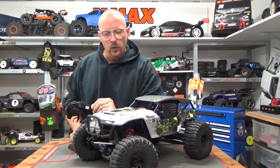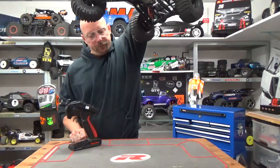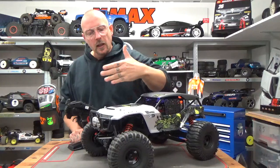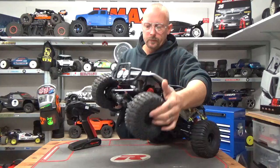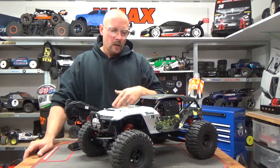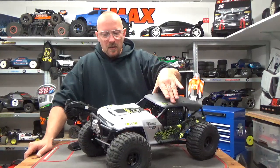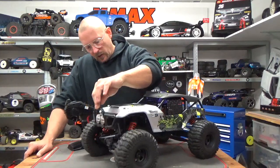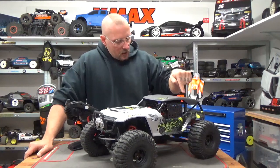The second thing to change when you get the Kyosho Fo-Xx is the suspension oil, because out of the box it jumps around like a toy and this is really not cool. It's a solid axle vehicle, you have super smooth damping left-right, but when all tires are on the ground, here you are really too hard. Look at this, the truck doesn't even come back. The old one does not do this. I don't know why they put stiffer or thicker oil in the suspension, and here the damping is really bad.